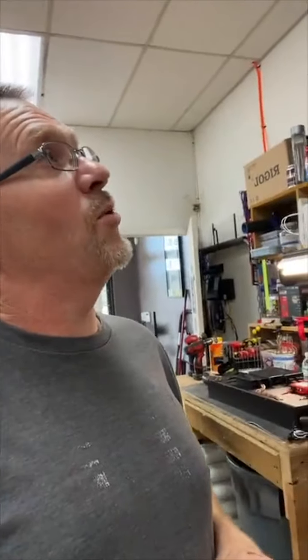But there's plenty out there. If you're looking for the best bang in town, a 4-channel amplifier, check out the Morel MPS 400.4. It's 70 watts by 4, class AB. Sexy as hell. But the new one, they only make in a 2-channel and a monoblock, so the 45th anniversary doesn't count. They also make the 5-channel, which is really cool because it's a split power: you get AB for channels 1 through 4 and then class D for the subamp. So it's really kind of cool, and they're extremely affordable.